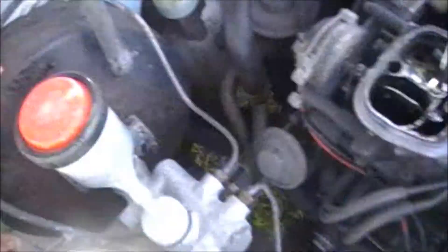The vacuum solenoid here — to adjust the idle when it's cold — I think isn't working properly, so I bypassed it, so it's getting vacuum all the time, because that normally only works when the ignition is on.